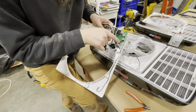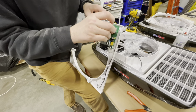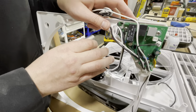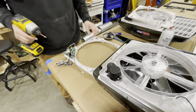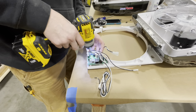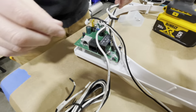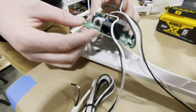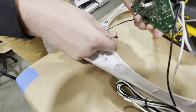There are three screws — one there, one there, and one there. And then this wire from the IR sensor coming over, so we'll disconnect that and then take those screws out. There are little tiny plastic washers where the screws are, so when you take those out, just be careful. And don't go ripping this thing out — there's a ribbon cable underneath it. As you pull it up, you can see that ribbon cable is attached. So grab the plastic, don't grab the cable itself, and just gently wiggle this back and forth and it'll come off.